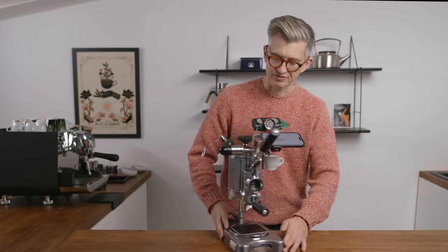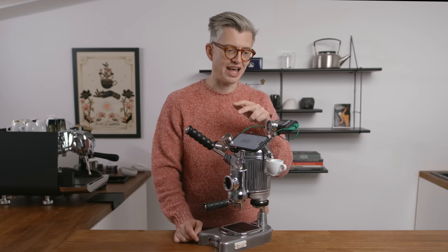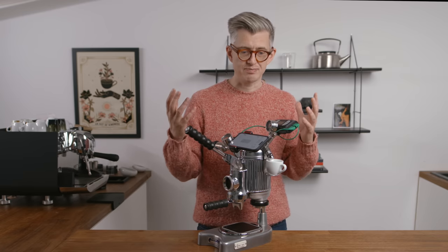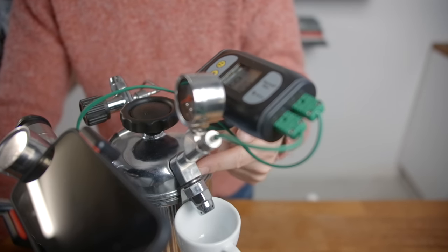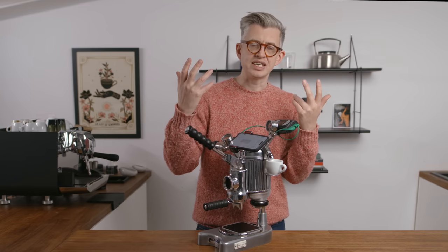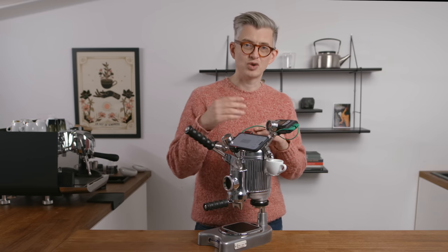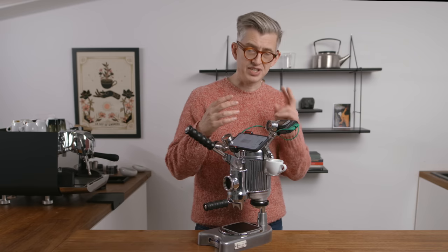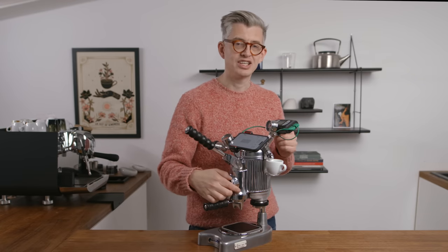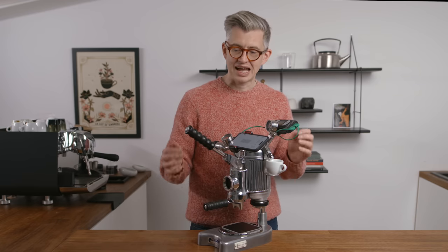What he added was really interesting though. This up here is a Bluetooth thermometer, and it's now able to talk to the Smart Espresso Profiler app. We put two temperature probes into the machine to understand what's going on. One probe runs inside the boiler, close to the element, telling you the temperature of the water. When you trap water and boil it, you can raise its liquid temperature above 100 degrees Celsius and create steam — that's how this machine has steam for steaming milk and also builds pressure for pre-infusion.